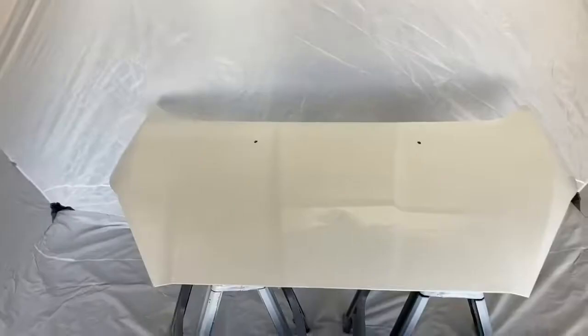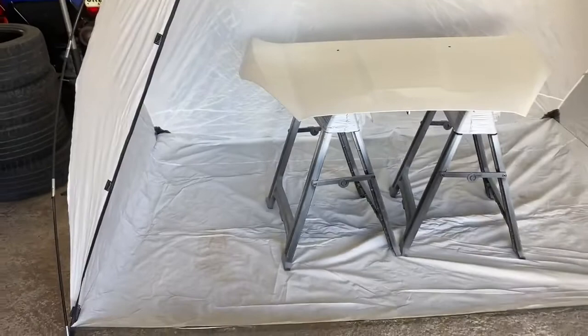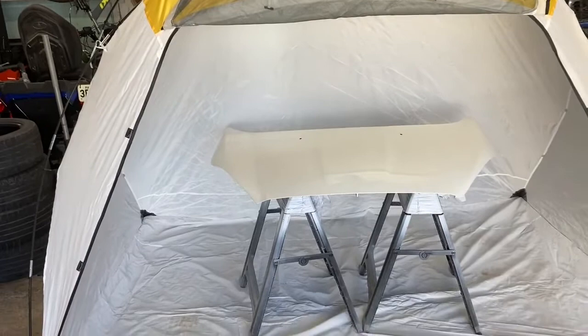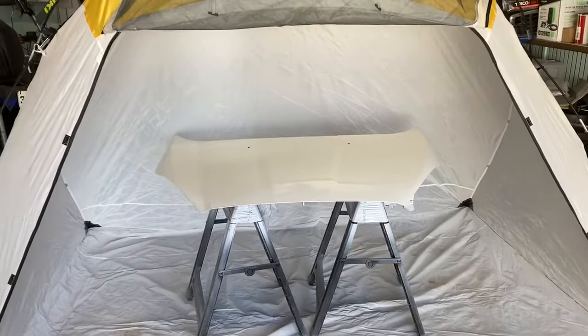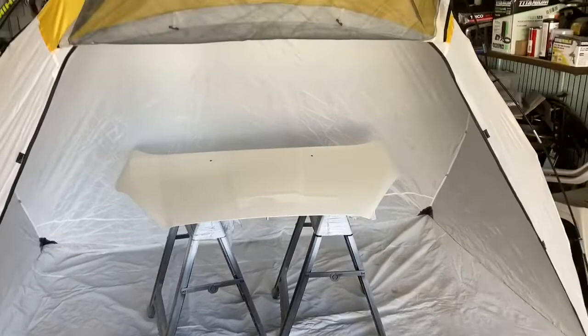Wow. Looks great. Hey, one thing I want to mention too real quick, guys, for this paint job. I actually used this Wagner painting tent. It's the largest one that you can buy. And I got to say, it was a little cumbersome to put together, but it worked great for a home DIY paint job. It kept the hood, or what you're painting, kind of enclosed, so you don't have dust falling down on top of it or things like that. I have very little trash in this paint. Of course, there's a few things you're always going to have, but nothing significant. And this tent really came in handy. And I think it was like $50. So for the occasional paint job, it really comes in handy. And I think it's well worth the $50 to keep junk out of your paint and make it look a little nicer. So I'll drop the link in the description for that, as well as some of the other materials that I've used in this video.